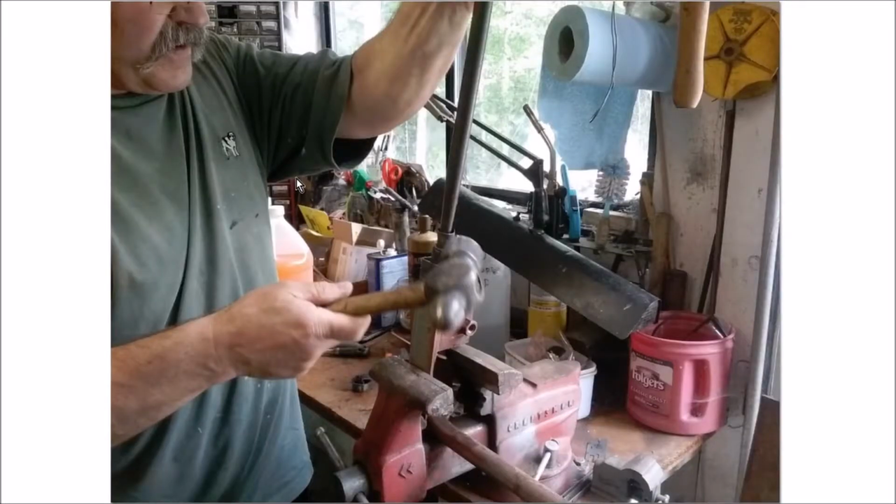So I drove the truck up to my friend's house, and my friend Kevin here, he's got a shop with some welding tools and metalworking tools. He opened up the frame, or sorry, the tubing with a smaller piece, and is using this giant metal awl and beating the tubing around it to return it to something resembling a round shape.